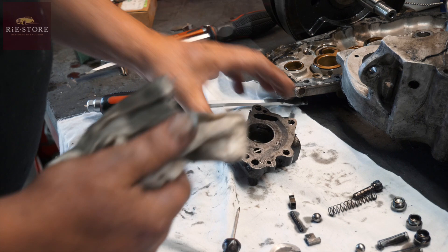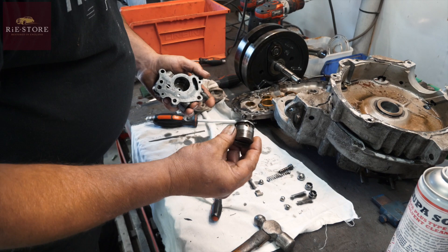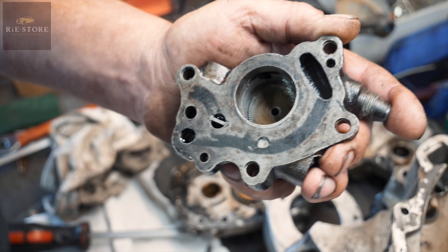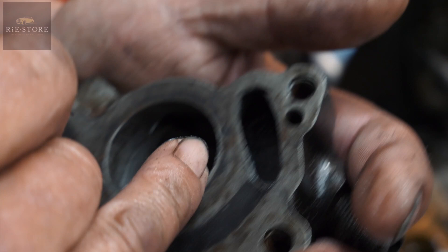Your basic assembly of the oil pump — put your rotor back in. That always goes in that way at that inner hole. Can you see that lip there? That is machined to a perfect round, which holds the back face of that — you can see where it runs in it on the bright side. The outer face has got your concentric on it. So when that's in there, you've got your gap. That basically is your oil pump.